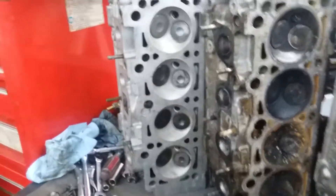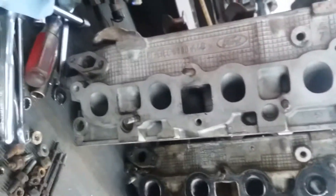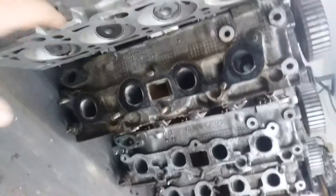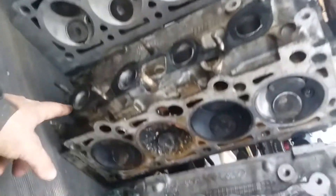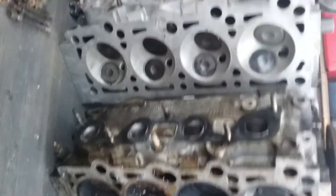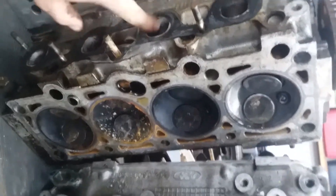We'll start way down here with the hemi-heads. This one is a 1981 casting of 1.6 carb. These ones have the smaller intake ports. We got another one, and this one has a worse casting. They are two different castings, but they both are 81 to 82 1.6s. So they have that normal intake port with the four ovals and then the center coolant passage, and they both have hemispherical combustion chambers. These two are more or less the same aside from the casting varying some.